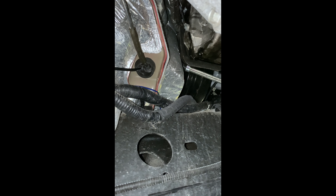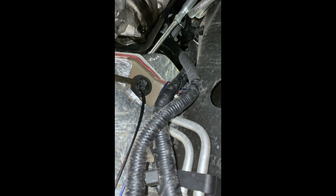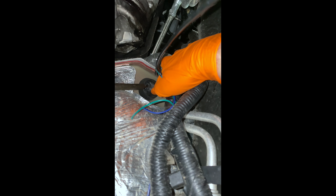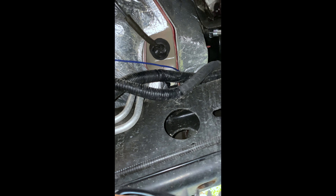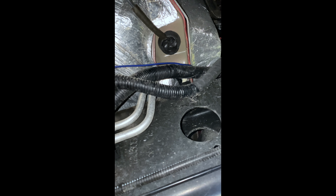That's where the wire comes through the floor, next to the transmission shifter cable. One of the other things I'm going to be working on — you see this blue wire they ran to the battery. I don't care for the way these are routed either. It's not in protective loom like corrugated loom, and there's no additional layer of insulation — just a single conductor wire. I'm going to be swapping that out later. Right now I'm just focused on getting this canopy glass actuator wire out.